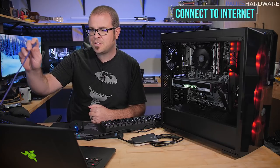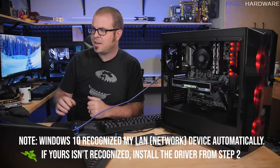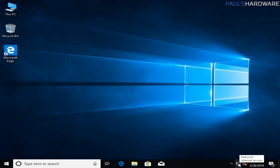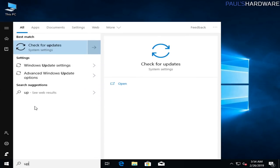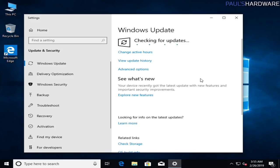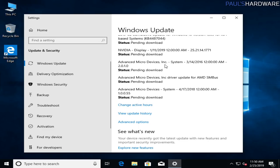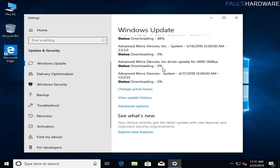I also like to turn off the People icon on the taskbar — personal preference. At this point we are ready to connect this computer to the internet, so I'm going to take my Ethernet cable and plug it into the RJ45 port on the back. When you connect to a network, Windows 10 will ask if you want to make your PC discoverable — if you're on a home network and want to transfer files between computers click Yes; if you're on a public network or not sure, click No. Now we have internet access. You should do Windows Update over and over again — access it by hitting the Windows key and typing 'updates.' Click Check for Updates, let them install, manually restart, then access Windows Update again. Rinse and repeat until it says you're up to date. Click update yet again to double check, then everything should be current.